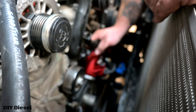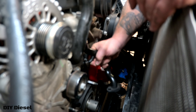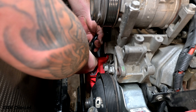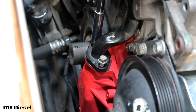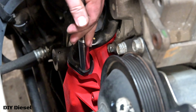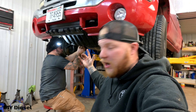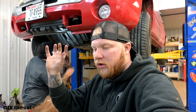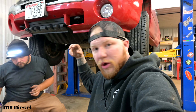Now we're going to add that coolant pipe. It's going to be extremely hard and really tight, so take your time and wiggle it in. It took us a while to wiggle it in. That's going to be two 12 millimeter bolts — get those on there nice and tight to squish that O-ring down. I could not find a torque spec on it, so I just got it really nice and tight. From underneath we slid the lower coolant hose back up onto the bottom of the water pump.